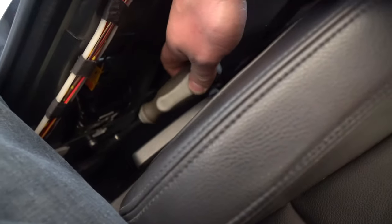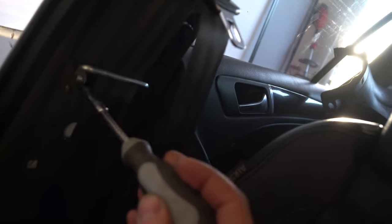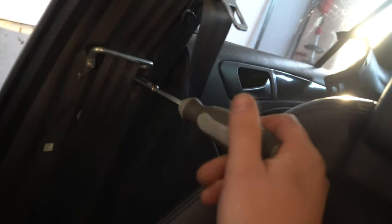When you go to put it back together, first thing you're going to want to do is tighten that bottom bolt. Just put the seat belt in just like it came out — put it down so the hook goes in and then tighten that screw in, then feed it through here. At this point, tighten this one up. Now you can put this bracket back on. For some of these like this bracket, this isn't under extreme tension — just make sure she's nice and tight. If you're really worried about screws coming loose, feel free to use some blue Loctite. But whatever you do, do not use red, because red is pretty much permanent. After you've tightened this and you've tightened these two bolts, now we can feed this through the clip through that black trim piece. That's going to go up here, and then we can put that off to the side. Just remember to put that black trim piece through before you bolt that bolt on, because if you don't, you'll have to loosen it to put it through.